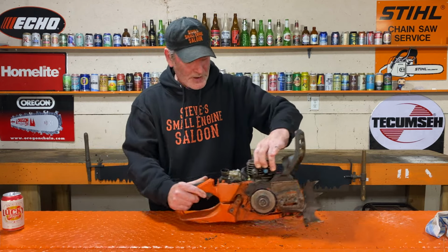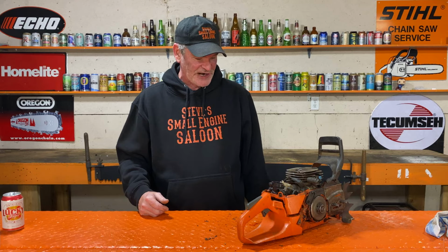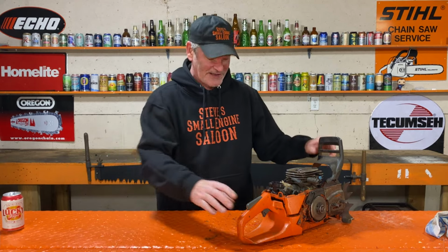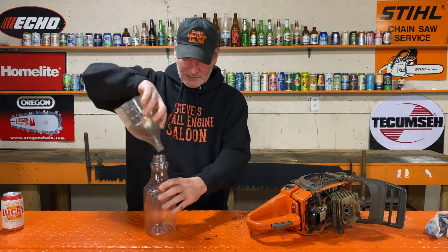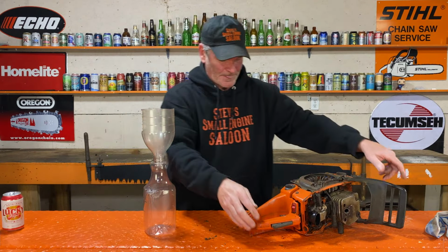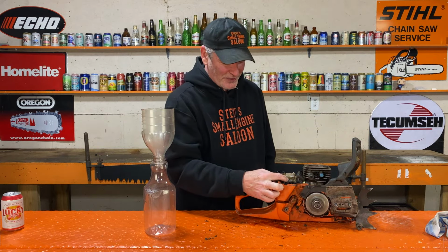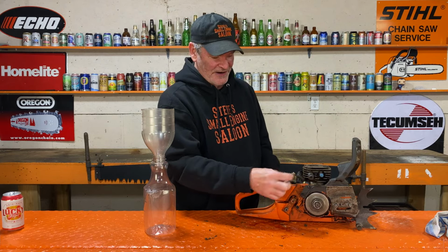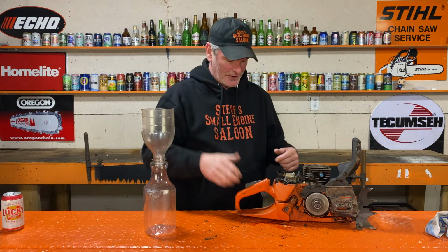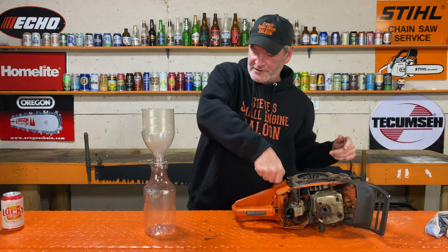Okay, and oh hey, you know what else we didn't check? Straight gas. A lot of you were saying, hey, you should check the gas. Maybe it's got straight gas in it, and that's why it's seized. Good point. Let's dump the gas out. Got to dump the gas out anyway. See, what made me remember that is because I got to take the fuel line off of the carb. And if there's gas in there, if I did that right now, there'd be gas shooting out, just like a cut artery. So I'm taking the gas out anyway.